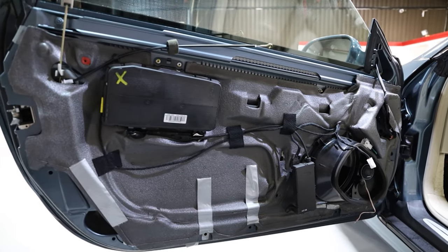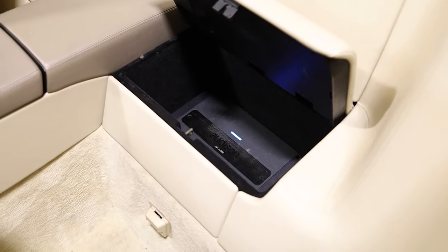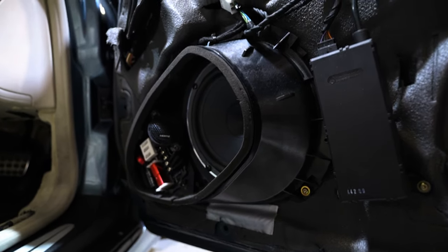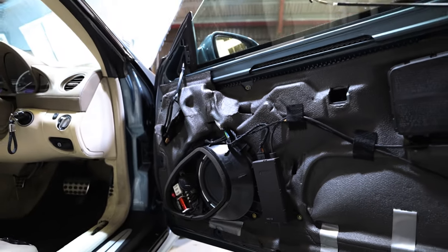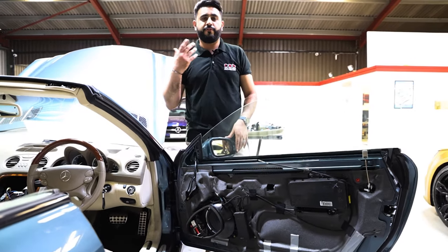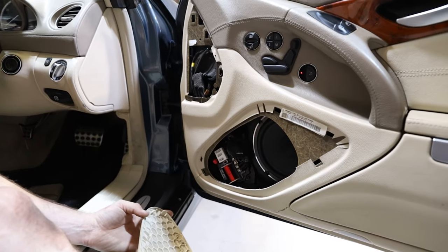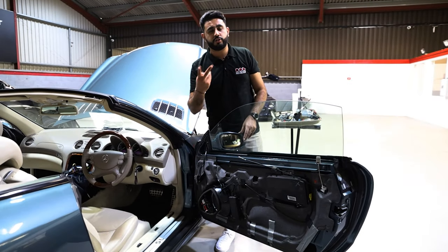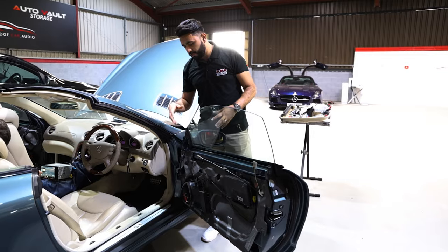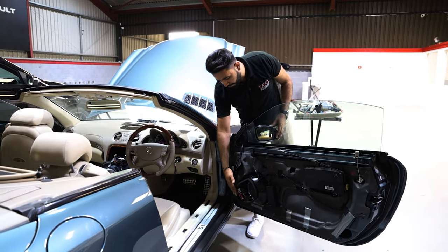The reason we've mounted the crossover in this position is that we're not actually utilizing it at the moment. What we're doing is running a four-channel amp fully active. However, if the customer wants to add rear speakers later on, we're saving them time and money — we can swap over the wiring very easily to allow the front to become a passive system. Fully active means each channel on the four-channel amp runs directly to individual components — two tweeters and two six and a half inch drivers. The other two channels can then run rear speakers, so we're thinking future-wise. It's not being used currently but it's there as a future-proofing measure.